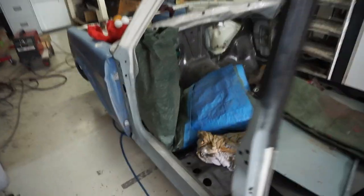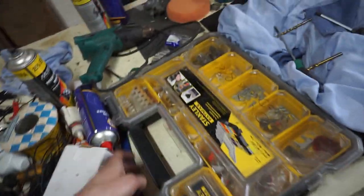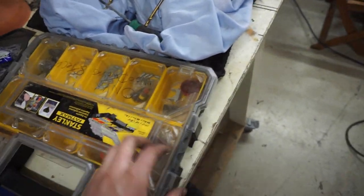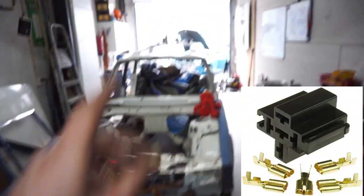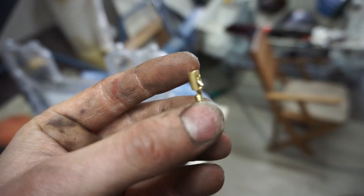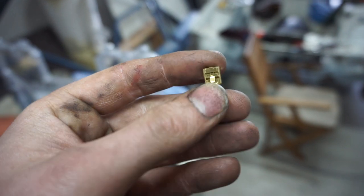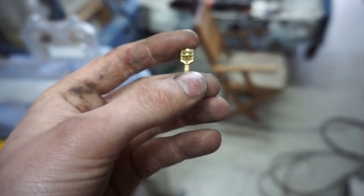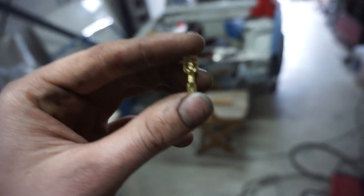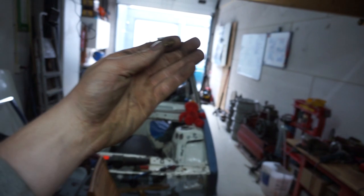Over here I have all my electrical connectors. For something like the relay connector, buy connectors that have a small locking lip on the end. What that does is lock into the connector housing, so you can press out the old terminal with a screwdriver, solder two wires onto the new terminal, and then use the original relay connector that came with your car — keeping everything looking factory.